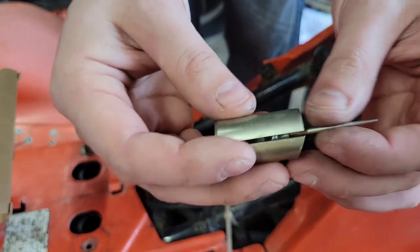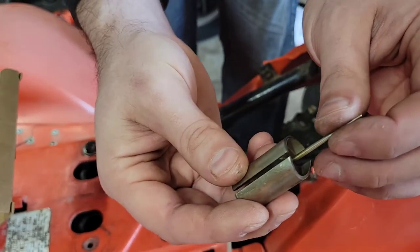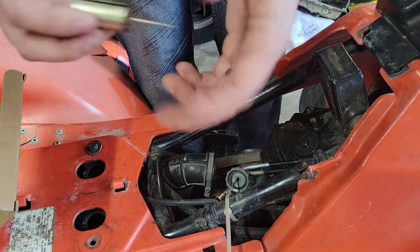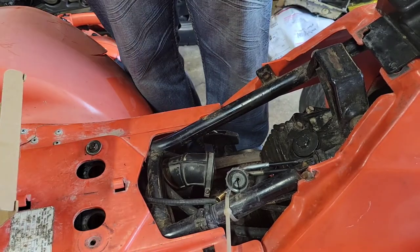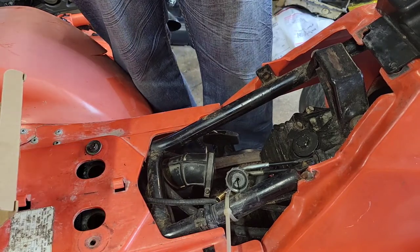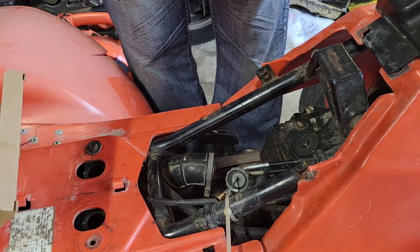This is also your main metering jet, and you adjust it based on the amount of fuel that it does or does not need. This one might have been running a little lean as it was all the way down, so that could have been a problem for me. But the other carburetor, I was always having to mess with the idle and the mixture adjustments. You go start up one day and it's this way or that. So, all right, we'll go ahead.